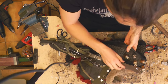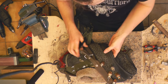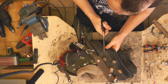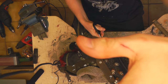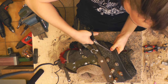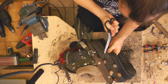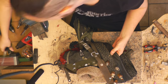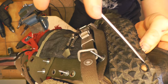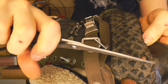So let's see how this is done. First of all you're gonna need a hole. What I do for that is cut a small hole with my scissors. Now be very careful with this — I've already cut myself as you see here, because this rubber gives you a lot of tension and when you slip there is a lot of force going right into your fingers if you happen to be as clumsy as I am. So I cut a small hole like this, and now what I'm gonna do is make just some incisions in an X shape — an incision in each direction.